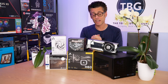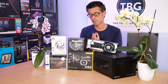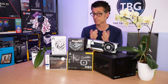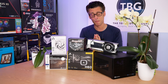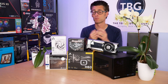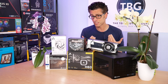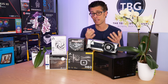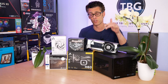To add a little spice to this review, I decided to also change up the various orientations of the fan. I'm going to look at whether it's better to set the H60 up as an intake or exhaust, and I may also test some third-party fans if the Corsair fan doesn't seem to be performing up to par. I'm also going to be checking GPU temps, because one of my concerns is that a liquid cooler either blows hot air onto your GPU or replaces an intake fan entirely, meaning no intake fan at all for your GPU.